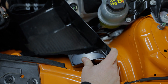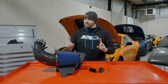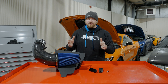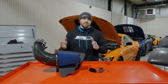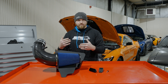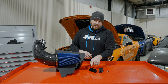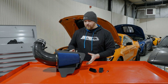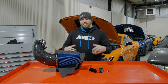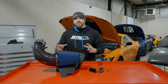When these cars come from the factory the engine isn't always sitting in the exact same spot. The engine mount bolts rest on a single stud on each side, so if you actually loosen those up you can shift the motor side to side roughly an eighth of an inch or maybe even more, and all that will mess with the positioning of the box in relation to the motor and the tube. So what we did is a nice isolator unit made out of Delrin and billet aluminum, and that allows you to push the box forward and backward and also give it a little bit of articulation so when the motor's moving and everything's shifting — whether you're under torque or just driving — it's not rigidly mounted.